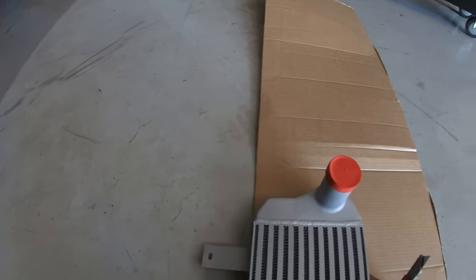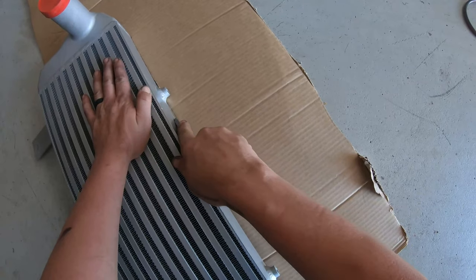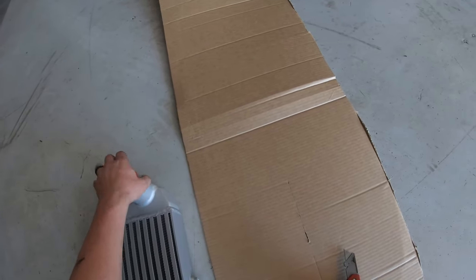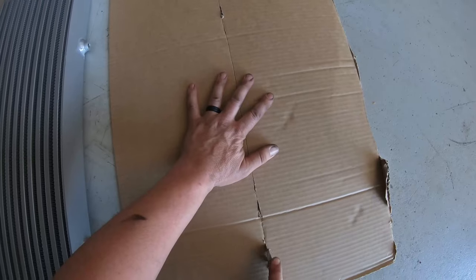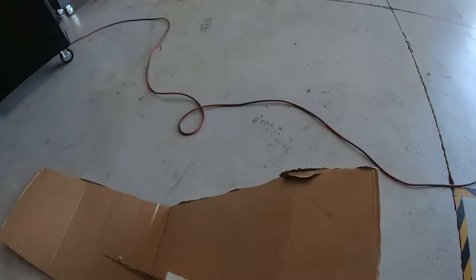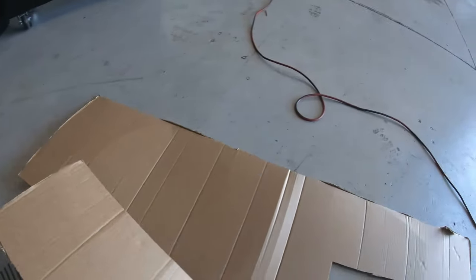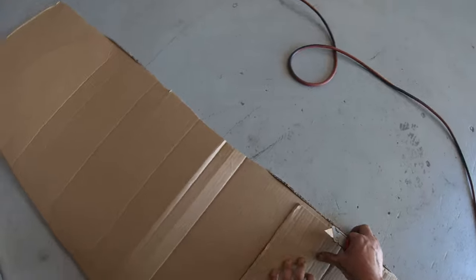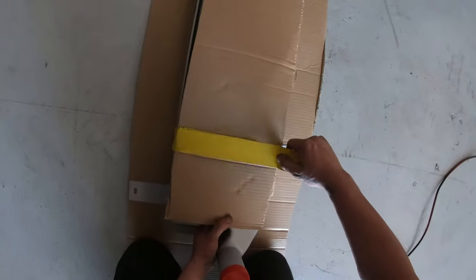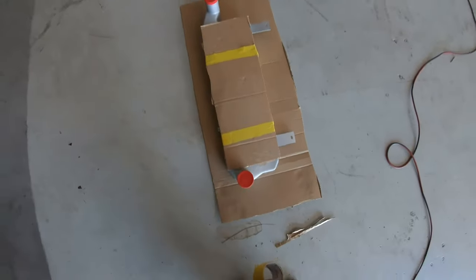Before I have a crack at installing this very expensive customer's intercooler, I'm just going to trim up a bit of cardboard that I can tape over the front and also over the back, so I don't damage any of the fins — the delicate parts of the intercooler. That way if something bumps it you're not going to run into an issue. All it takes is one little tiny bolt to stab through, so we're going to mask that on. Perfect — now I can tape that up. Done. Now we can install it without fear of hurting the core.